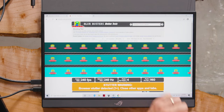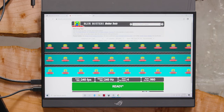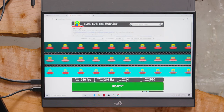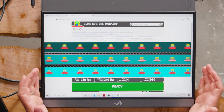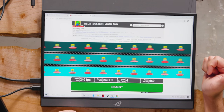Now if I track an individual element and follow it with my eye, I can actually see some ghosting on it — but it's pretty good motion clarity. The test ship is designed to have elements that tell you how much blur is going on. If this were a paused image, you can see the little guy up here — he's got three green eyes and the ship has white dots on the side, actually three dots per section. 240 Hertz really helps a lot with clarity, even on a fast IPS panel, which doesn't have as quick pixel response times as TN panels.